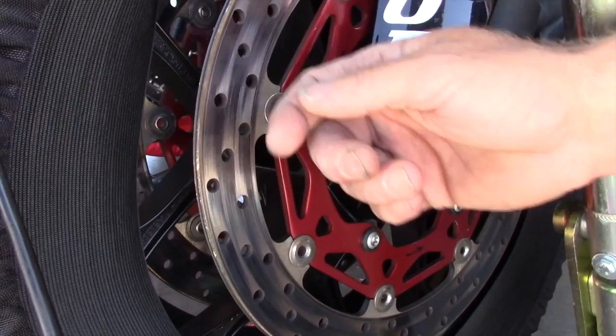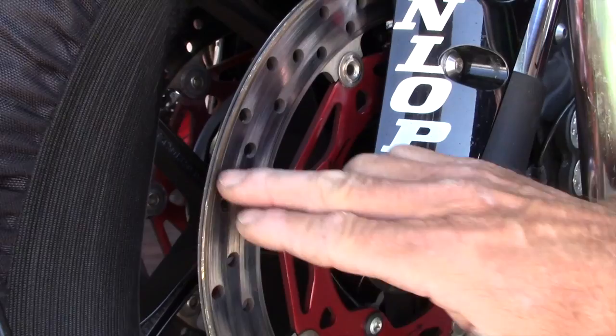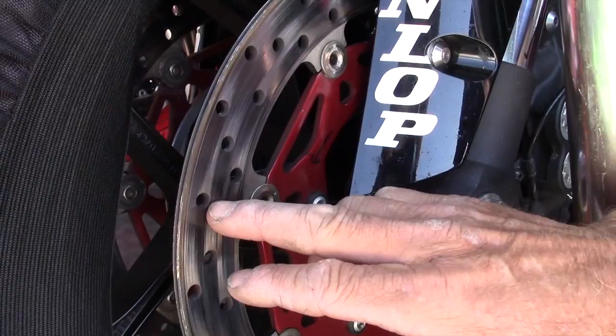Because the rotor is predominantly black, not silver, in terms of racing this R1's braking efficiency is significantly reduced in the corner. So these rotors need to be urgently sanded down so that the pad can contact the rotor surface — not the old pad material. Anytime your rotor has all these black high spots or comet tails on it, you are in urgent need of attention.